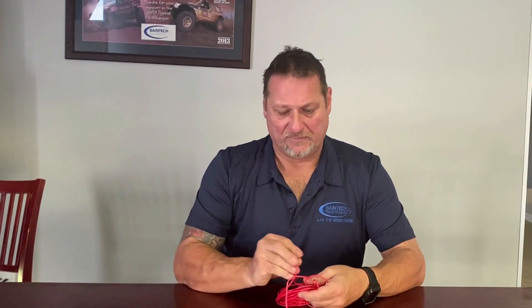We're getting a lot of calls from people saying their battery is dead and won't accept a charge. I had one customer who drove all the way from Cairns down to one of our suppliers in Mackay to fix or replace their battery, and all it was was the DC-to-DC not outputting because they had run the battery flat. They had been off-grid without solar, and the fridge and other devices drained the battery after a few days. They assumed the battery was at fault when it was actually the DC-to-DC safety feature doing its job.